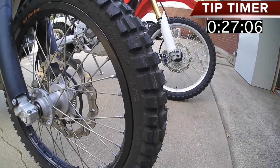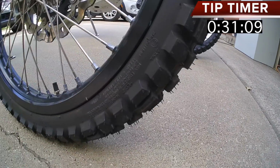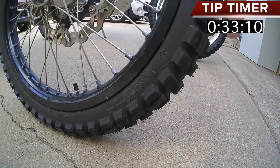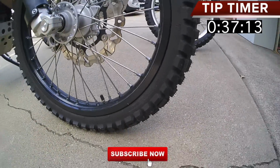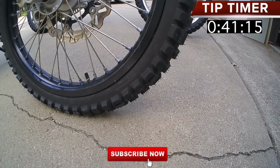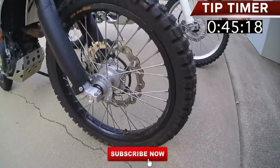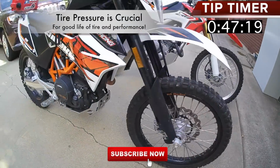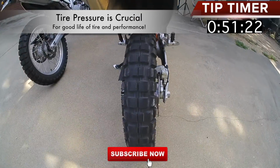Now, what I like to suggest is that basically, if you look at my tire, it's a fairly new tire, okay? Every tire has information on it. You'll see right here, it will actually tell you what the max load is, the range, all that stuff, PSI levels, the whole 9 yards. If you're riding on street, I totally suggest running them at least all the way up about 90% of total PSI, which mine's like right around 32. They're all going to be a little bit different. Definitely on your rear tires too. You want to air those up.